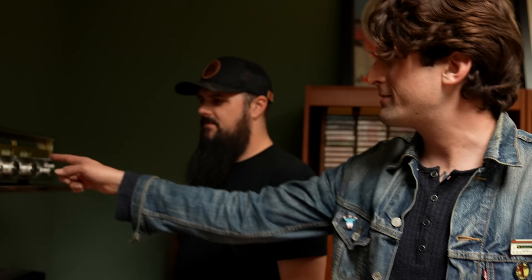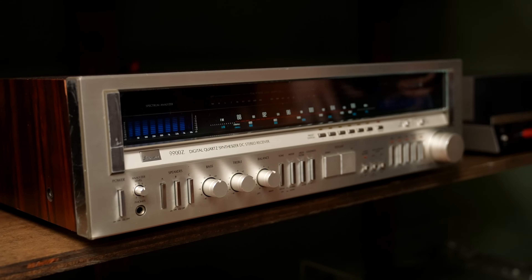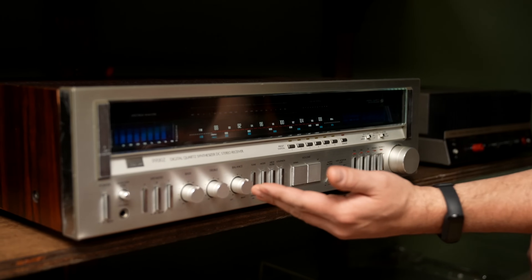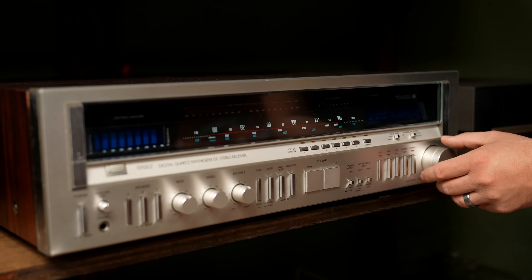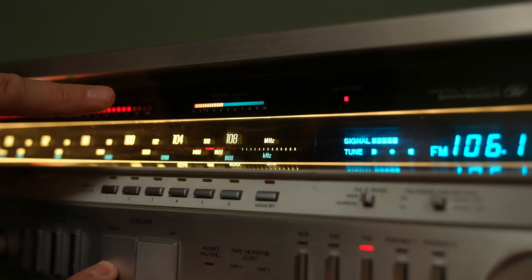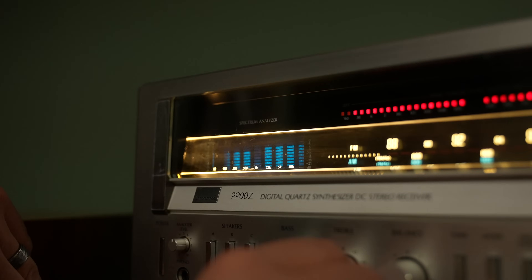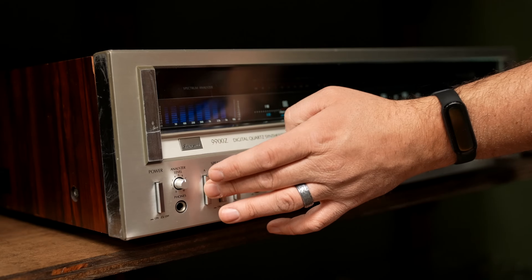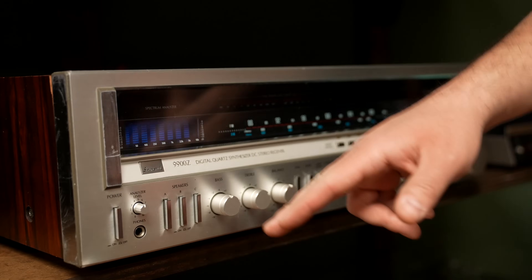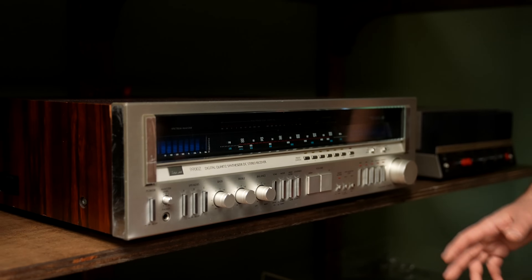The series after the G series is the Z series. This is the top of the line in the Z series, entering the 80s — not quite all digital yet. All the companies did both: they kept an analog tuner but added a digital display. There are meters at the top going out to the sides, and an EQ spectrum analyzer meter as well. It's a monster receiver at 160 watts, with A, B, and C speaker outputs. The one thing it's missing for a true monster is a mid control, but it has lots of controls nonetheless.